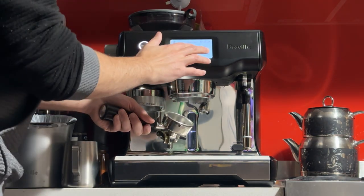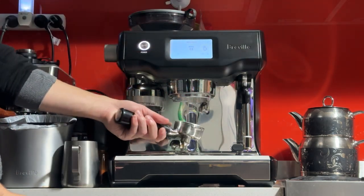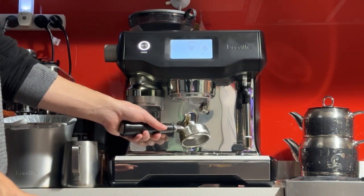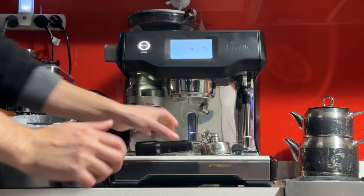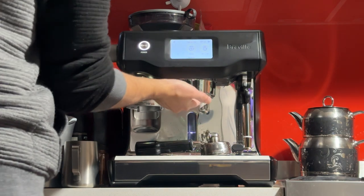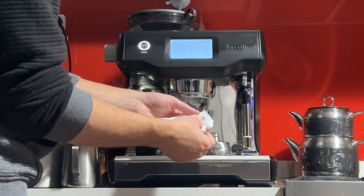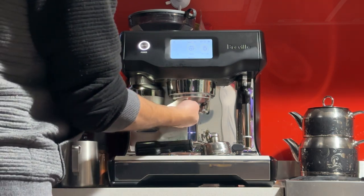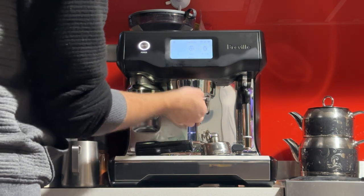Next I'll be doing the flush — I do this with every machine and I highly recommend it. Instead of going all the way to the sink and rinsing the portafilter, I just do a few seconds of brewing. That's going to clean your portafilter and your shower screen in one go. If you want to be extra nice to your machine, grab a tissue or a brush — it's included with your machine — and wipe the shower screen. There's almost always a bit of coffee grounds and oil even after you flush, so a quick scrub with a brush or tissue takes care of that.